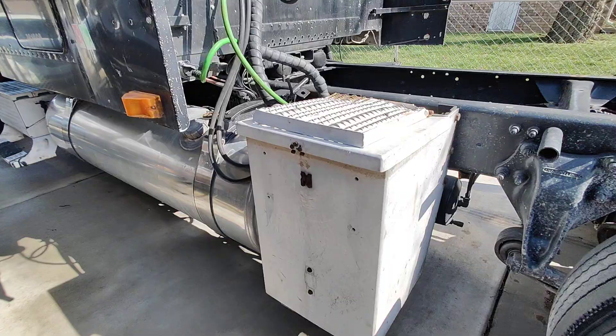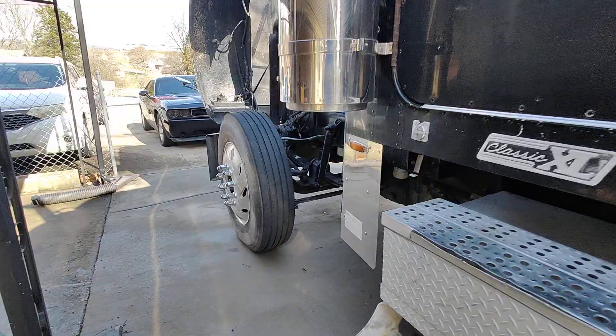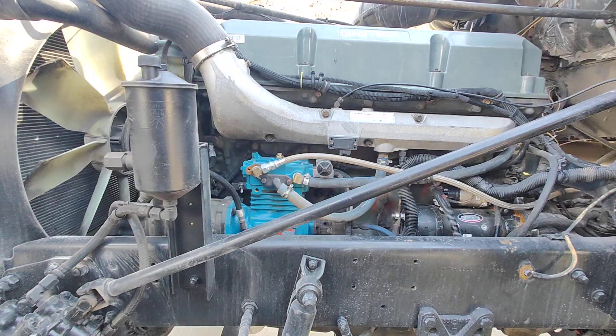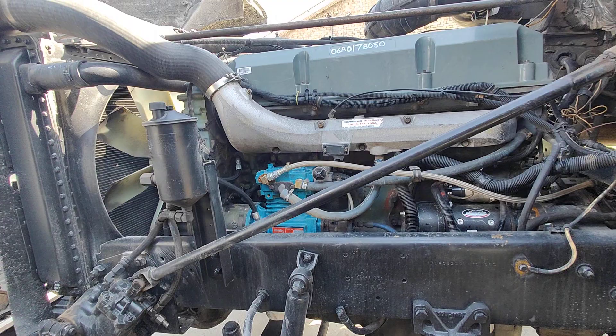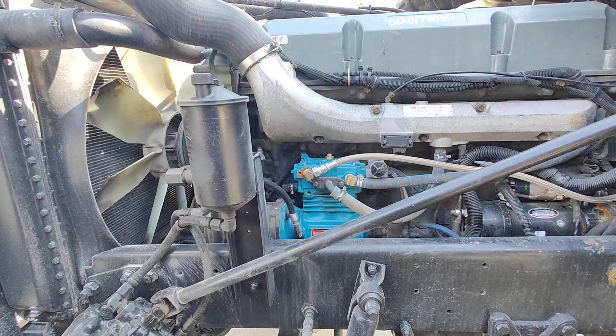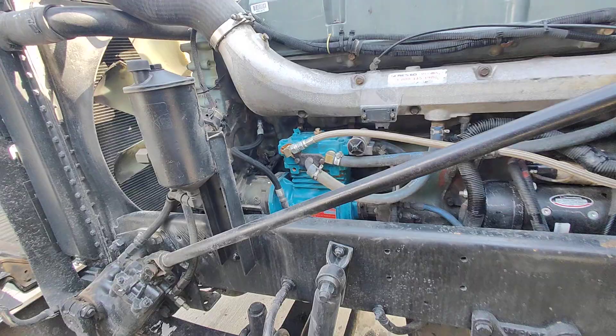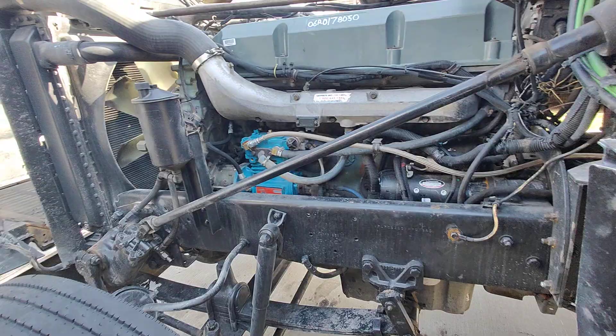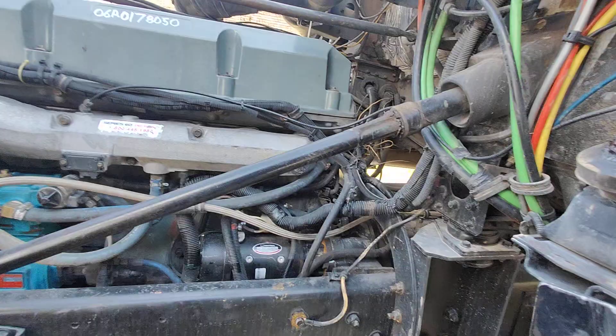Truck is ready to go, ready to be tested. It's already peaked in tune, but it can still be modified. I won't know until I put a load on and see. We'll try and get 40 PSI on that boost gauge. We're pushing somewhere between 600 and 650 horsepower to the flywheel. Fuel prices came down and what I charge went up — when fuel was $5 I didn't have a problem, so at $4 I'm doing wonderful. Brand new starter, brand new air compressor, brand new air governor. Some of these hoses are brand new. Got the pyrometer hooked up but it doesn't work, so it needs to be replaced. Got a new oil pressure gauge going on.